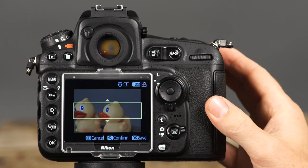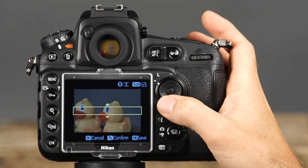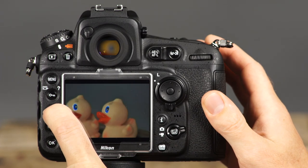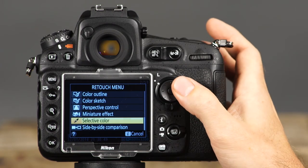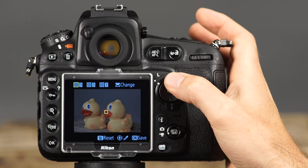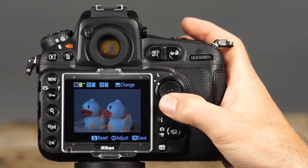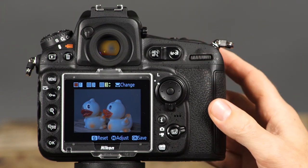The miniature effect creates images with similar effects to photos taken with tilt-shift lenses. Use the sides of the multi-selector to choose the size of the field of focus, and the top and bottom to choose the area of focus. Press the zoom out button to change the direction of the field of focus. Press and hold the zoom in button to see a preview of the effect. When satisfied, press OK to save the image. The selective color effect creates photos that have only selected colors shown in an image that is otherwise black and white. Use the multi-selector to find the area of color you'd like to select and press the center multi-selector button to select it. Rotate the main command dial to adjust the range of colors, and you can select up to two additional colors the same way. Press OK to save a copy.